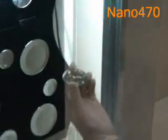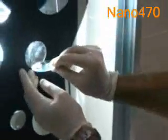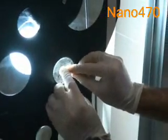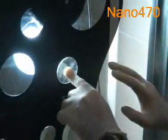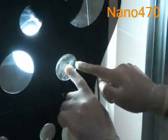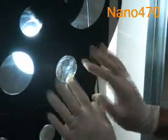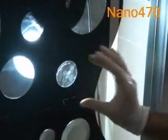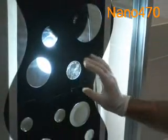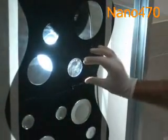Place our bevel on. Now you've got probably about 20 seconds before that starts getting hard for curing. So push in the centre to remove any bubbles. Make sure that the adhesive flows out. When you're happy, leave it. By leaving it, letting the stencil hold it in position, we're right. Again, count to about 30 seconds. Now once that's cured, we'll move our suction cap over to do this one.